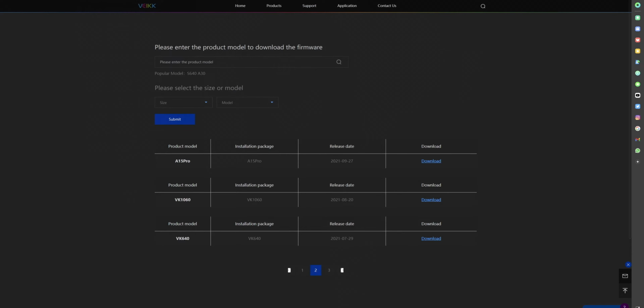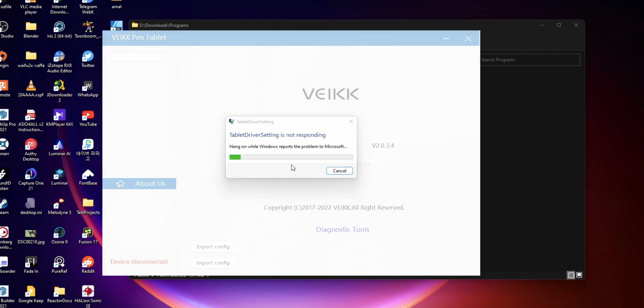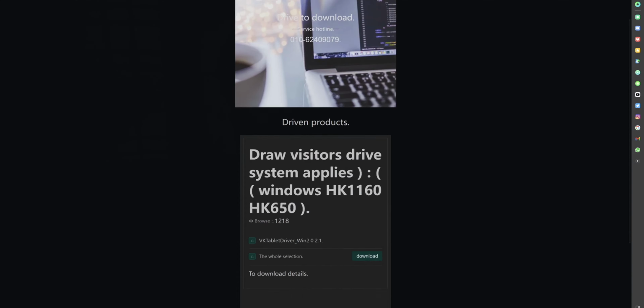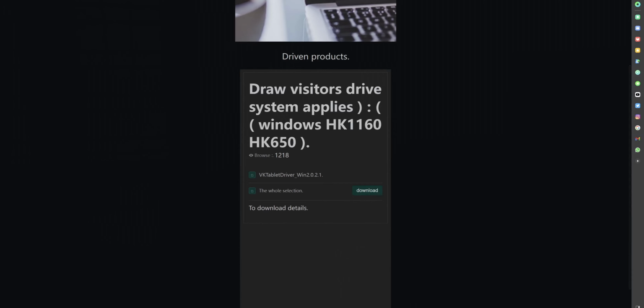tablet. After that, to update the firmware, we need the Veikk software. We don't want to download the Veikk software which is available on the Veikk website, because on that version we can't update the firmware. So to update the firmware, we need Veikk software version 2.0.2.1, which is only available on the Chinese website of Veikk. The link will be given in the description. Head over there and download the Veikk software from the Chinese website.